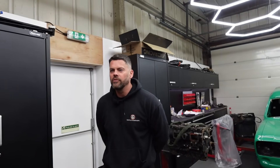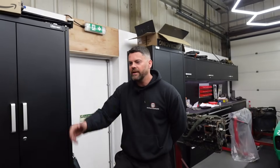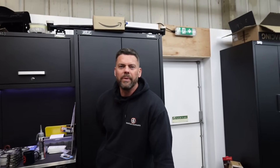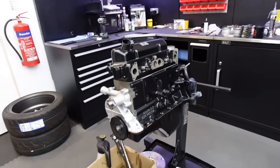I'm going to see how we get on with this cross flow because part of me needs to stick with it. I like that little 1700 cross flow — they're a neat little motor, tiny. I just can't believe how quick that one and the other car is. What I'm going to do is when Stuart takes the rocker cover off, I'm going to measure the lift and see what we've got in there. It'd be quite interesting because it'll tell us roughly what power we're going to be running. You can get good power out of them, good revs, loads of bits for them and easy to build. Plenty of options, mate.